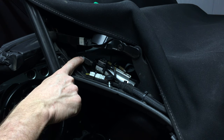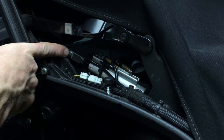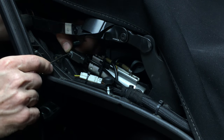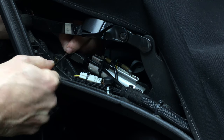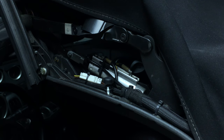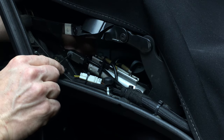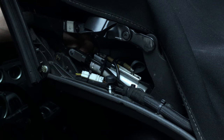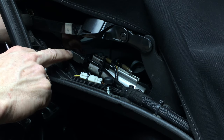Now we're down to taking off two circlips. One circlip is in the front — I'll show you how it's done. It's a nice controlled motion: you stick a small flat screwdriver in the gap and walk the thing off so it doesn't go jumping out of the way. Just a nice controlled motion — push the pin out of the way. Actually, the bow needs to be moved forward, extended, to get this pin out all the way.